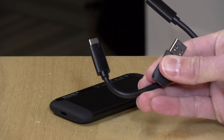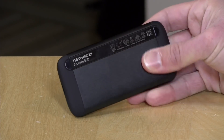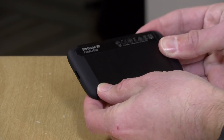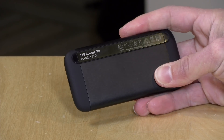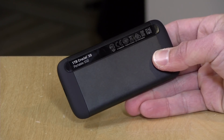The other option would be to get a cable that has USB-C on one end and USB-A on the other — that's my only gripe with the included accessories. Micron's not the only company that does this; WD does it as well, so just be careful with the cable. Otherwise, the build is metal and feels very nice. It's got rubberized ends to help absorb any impacts. And again, this is completely solid state — no moving parts inside, so these drives work very well if you're often downloading photos or video on the go. If you drop it, there's very low likelihood of data loss since there are no delicate parts inside that can get damaged. SSDs cost more than traditional spinning discs, but you get ruggedness, and the casing feels like it should keep everything inside well protected.